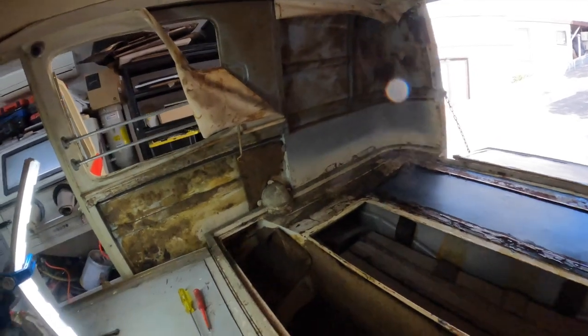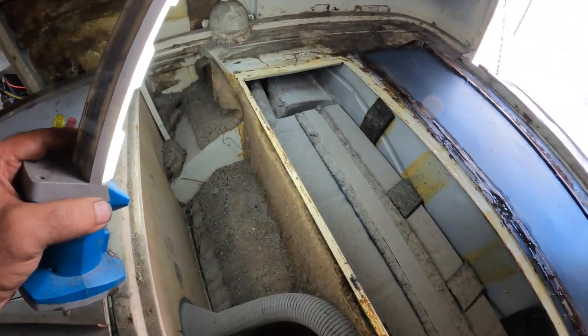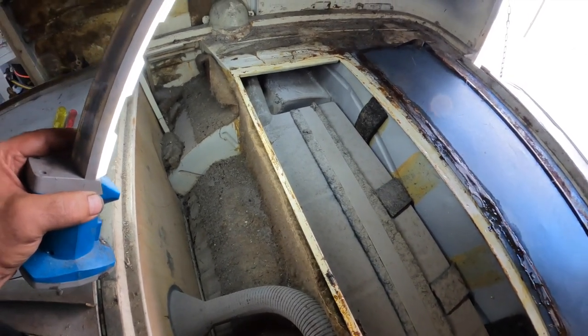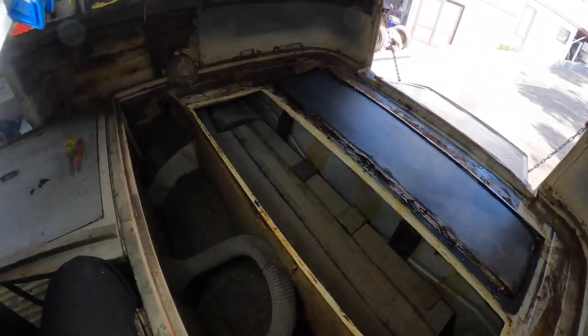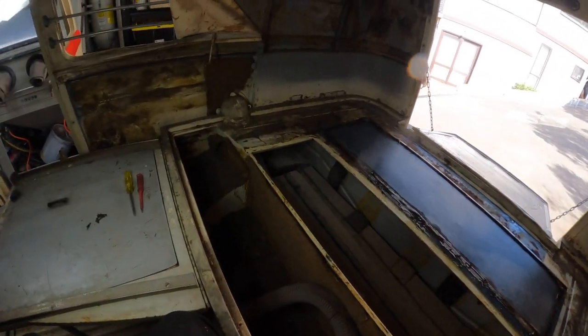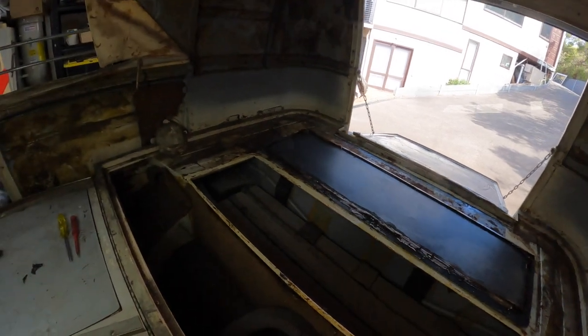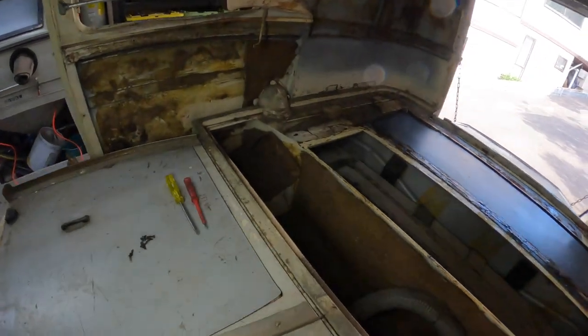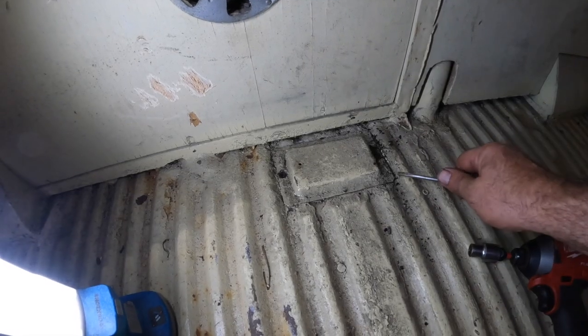That totally different fuel tank had to be removed anyway because it needs sandblasting, and all in here needs cleaning and painting. We'll take that other plate off — it goes straight to the engine bay, no big deal. Let's move on with the gearbox. We'll take off this little plate down here — looks like a 10mm — bust this out and remove the inspection plate. There are our little screws that we've got to undo. I'll go and get the appropriate spanner. Grub screws are removed — let's put this thing back up in the air and continue getting the gearbox out.